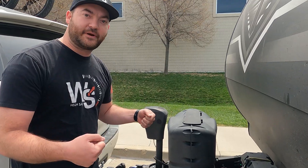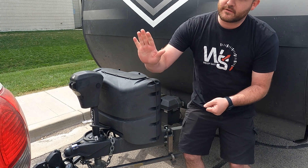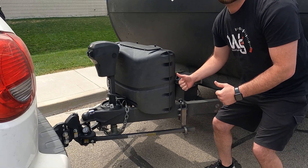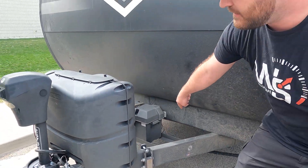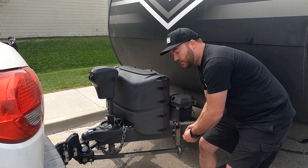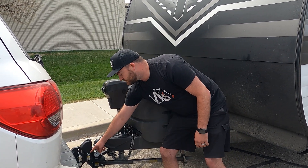Great question. The wheelbarrow effect — these spring arms are being lifted up by the trailer frame to push the front of the vehicle back down, because you lose a lot of weight off your front axle when you put tongue weight on. So we're trying to push that lost weight back on. But as you can see, these are being pulled up, which also means they're pulling down on the tongue of the trailer. Some of that pull-down force gets added to your axles on your trailer, and the other portion gets added to your original tongue weight. We call that a resultant force — the distributed tongue weight is a resultant force of these being pulled up, pulling down, getting out of the tongue weight. Our app calculates exactly what that resultant force needs to be to be truly distributed.